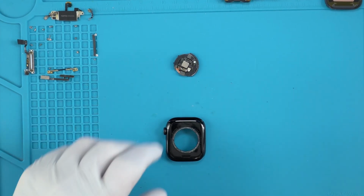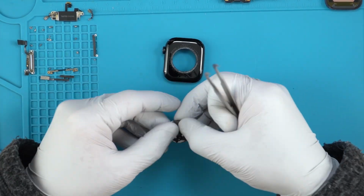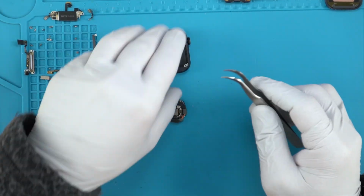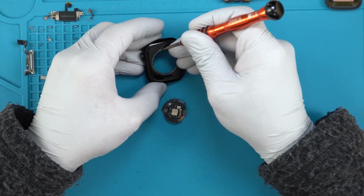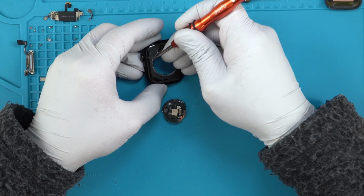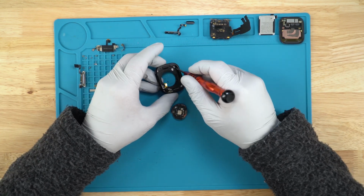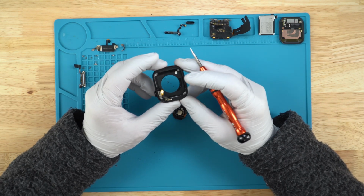Okay, so that's where our adventures come to an end here. So we got that concave lip. Here's the heart rate. So you got your sensors, your 4 lights, another one in the center there, ECG, your wireless charging. And they're probably using some kind of glass to metal bonding agent of some kind, because it's not completely rock solid hard, but it's also not as soft as an adhesive. It crumbles apart a little bit, unless that's me scraping the plastic right there, because this ring over here does seem to be more of a plastic material. So this inlay here could be some other material, probably not plastic, but maybe a fiber of some kind.